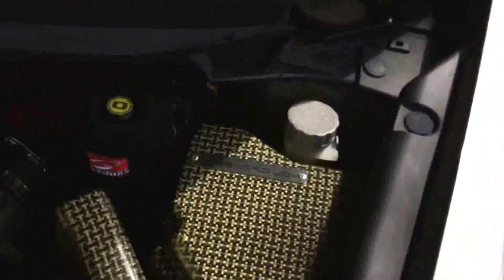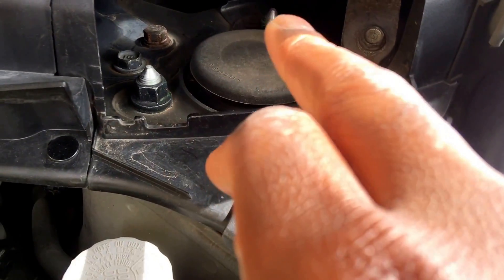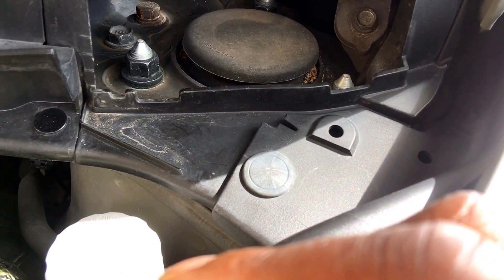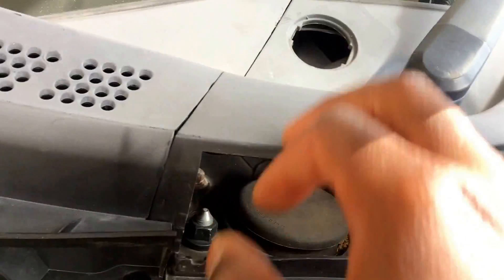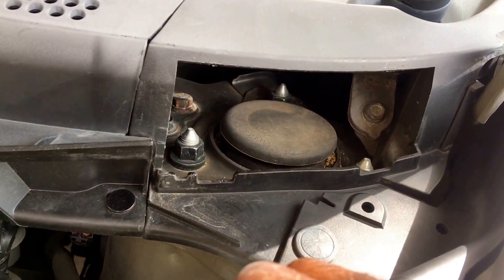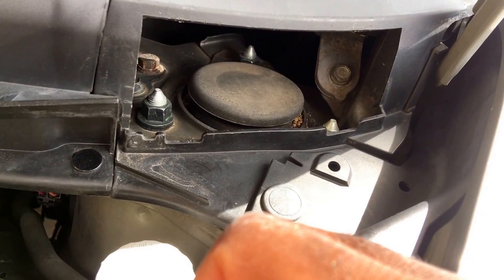I figured out how to get to these bolts. You can get a socket on both of these bolts and bust them — make sure you do both the two front bolts first, and the third bolt in the back last. That third bolt in the back was giving me a pain in the ass. You go through this hole. Put the wipers up and you can get that long extension tool on that one. Take all three bolts out. You can do it on each side — see, the hole's uncovered now.